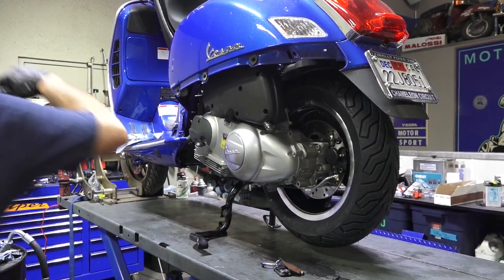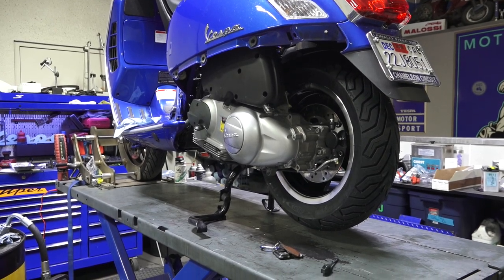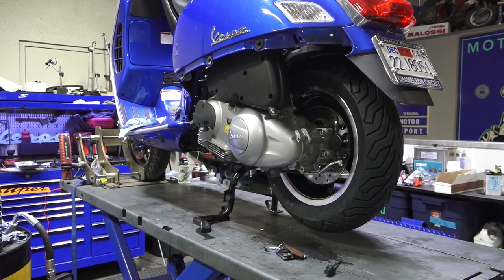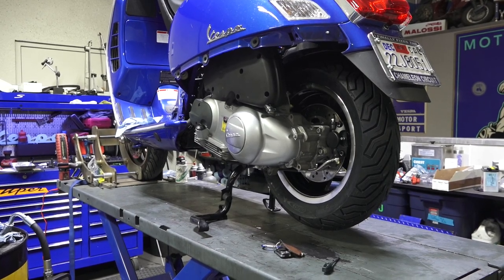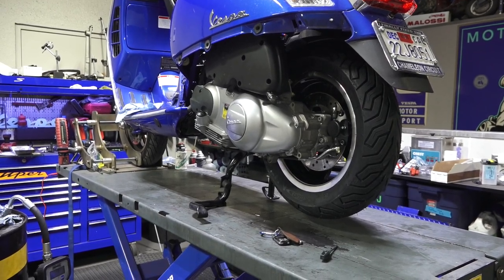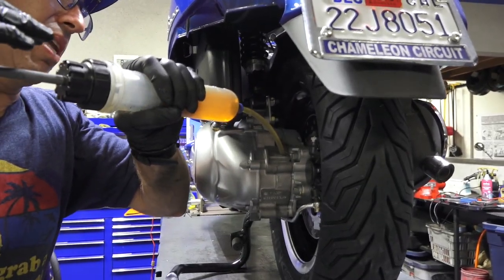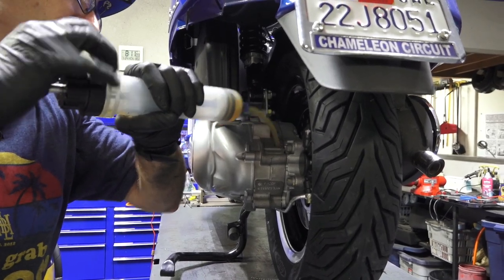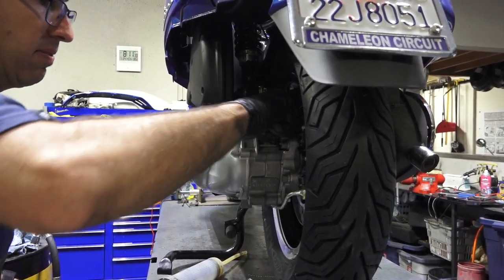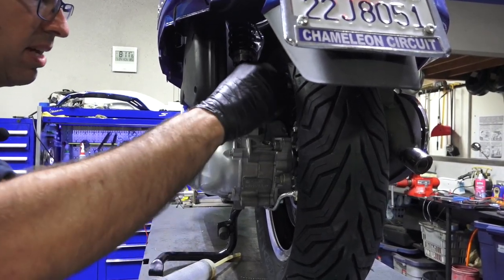Our gearbox oil. I'll put, getting kind of low on the oil there. I put, maybe, let's see where 200 puts us. It was a drained gearbox. So this is a nice handy, it's a big syringe specifically for this. Makes the job a lot easier than pouring it in with a little funnel or using a small syringe. But a small syringe is perfectly adequate if you're only doing this every year or 2 years or whatever. So thread the dipstick in and it's perfect. It's right at the tip.